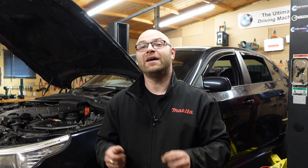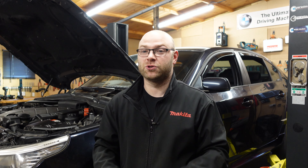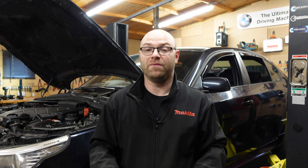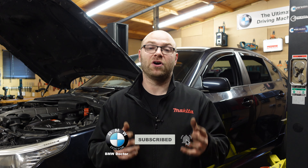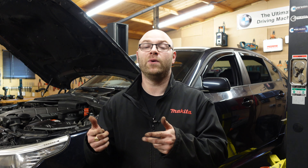So as you can see now, I've installed the LCI headlights to this BMW E60. The next video will be regarding the tail light upgrade and the LM2 module, so I can make these headlights actually function, because these will not function on the LM1 — they need the LM2. At the present the eyebrows are just coming on, but once I do all the coding and the LM2, these will be fully functioning along with the tail lights and the headlights. Those adapters I won't be able to link purely because I got them from the USA, but if you are in the US you will be able to find them online — they are $39 for a set of two. If you can't find them, just let me know and I'll try and help you find them. For people in the UK, you won't be able to order them unless you have someone in the US willing to ship them to you, as they do not ship to the UK.